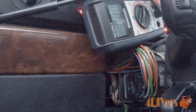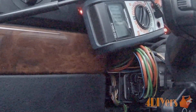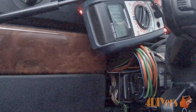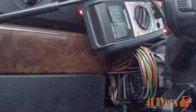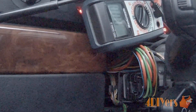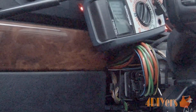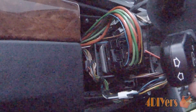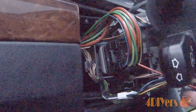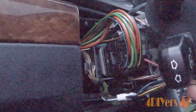Next, move on to the top side as well. Once you've done this, you will need two hands, so somebody else may have to help you — or if you have the alligator clip setup, you can do it yourself. When you put the key in the spring-loaded start position, test the outside wire here to see if it's getting any voltage. If it's not getting voltage but you do have power on the inside wire, there is a problem with the connector inside. If you are finding a matching voltage supply from the red wire going out to the yellow and black wire, the switch is functioning correctly and there is some other fault with the system.